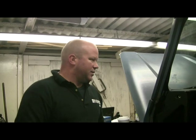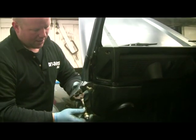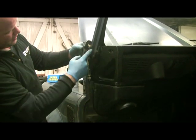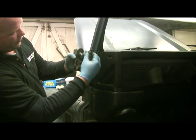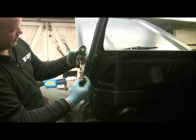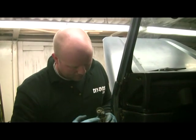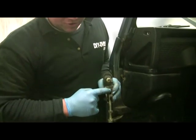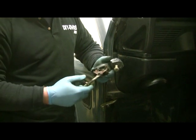We are doing the bulkhead, so it's going to be a big job, but we're going to do as little as possible to get it out. Somebody said to me you can get it out without taking the windscreen off from the roof, so I thought we'd have a go. All I've undone is this here — that's the hinge on the outside. Big screw through the top, two Allen key bolts. Loosen that off, close it, pop that down out of the way, and out it comes. Same crack with getting anything off — that goes to the compressor. Drill it out if you can't get it off, and just hammer and chisel it. Or drill that out, stick something in there, bend the head off — same with that. Drill it out, hammer and chisel the head off, whatever you've got to do.